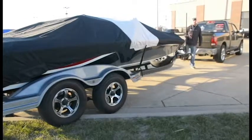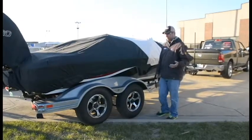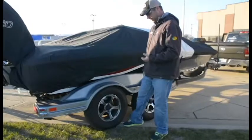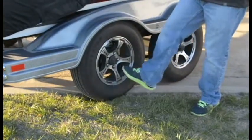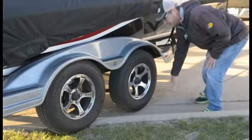One little aspect of this I always tell people: lock your emergency brake once you get the boat backed up on the curb. When you back onto the curb, you want to make sure that the tire is actually touching the concrete. If you go too far back, that tire is going to sink lower and won't be able to free-spin completely.